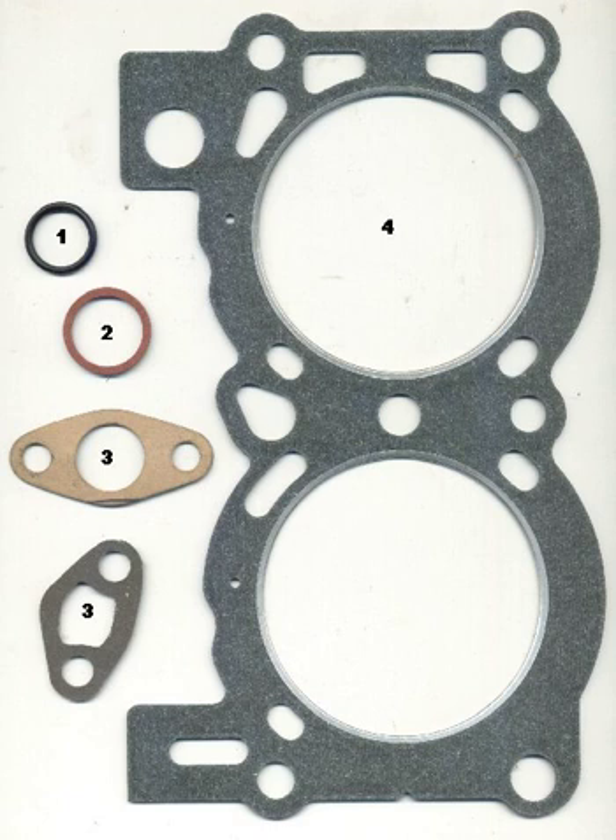Solid copper: a solid sheet of copper that typically requires special machining called O-ringing, which places a piece of wire around the circumference of the cylinder to bite into the copper. When this is performed, copper gaskets are extremely durable. Recently, companies have started producing copper gaskets with integral sealing wires, permitting their retrofit into engines without removal of the engine block for machine work.